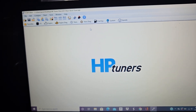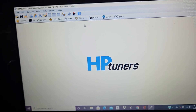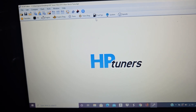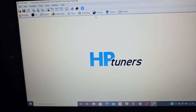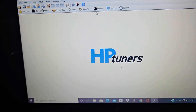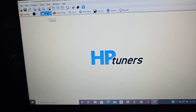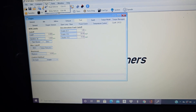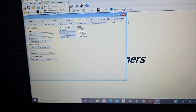From here, it's pulled the tune from your system so you can go in and do whatever you need to do. There are a lot of options in here — a lot of stuff you can change, and a lot you can mess up if you don't know what you're doing, so you have to be really careful. There's the option to disable the MDS system, change the idle, change the air-fuel ratio, and more. It's probably recommended to work with a professional tuning shop for all this. But once you're done making any changes in the engine, fuel system, or whatever it might be, you just go back to Flash and then write to the vehicle, which will send it back to the computer system in your truck.